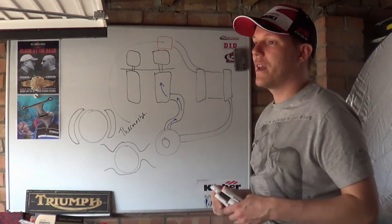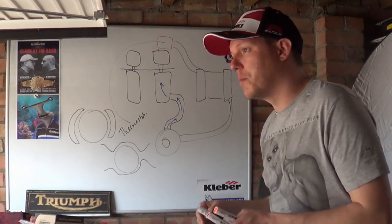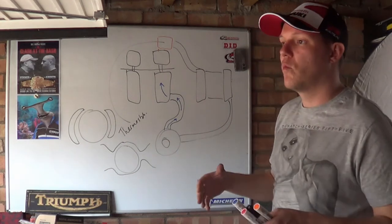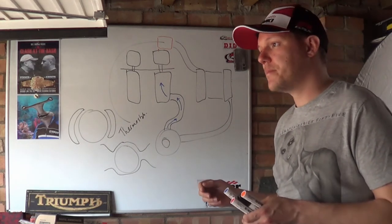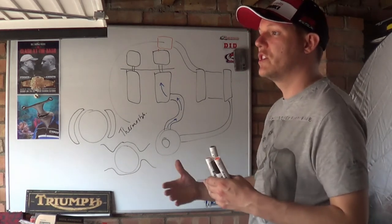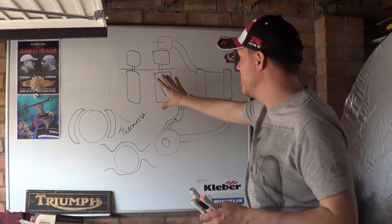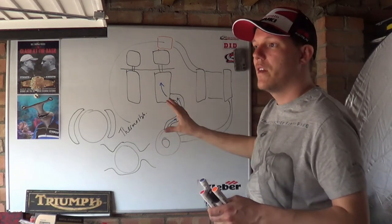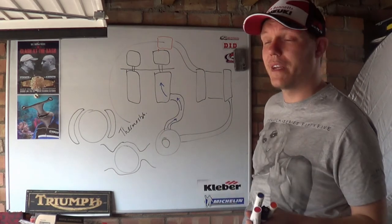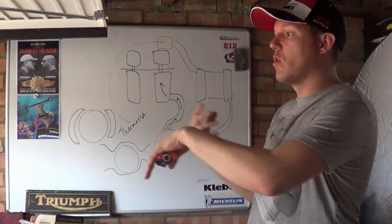But we have a thermostat. And why do we have a thermostat? Well, the impeller of a water pump is what we call an open cell impeller, which basically means that water will flow through it and you impart energy, just like a turbo, you give energy to the flow of water to push it along. However, if there's a restriction for some reason and all this water stops, it will not cause the impeller to stall. The water can just flow around it or just stop completely, and the impeller can basically just make a vortex. It can just spin the water in a local region.